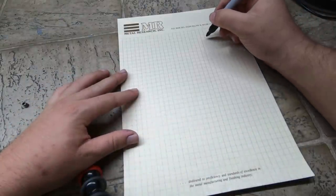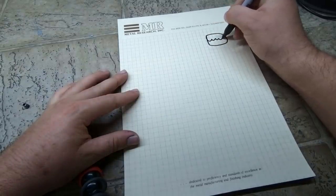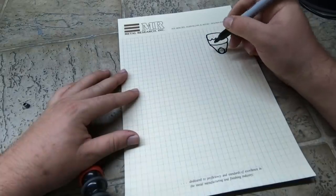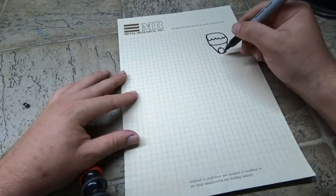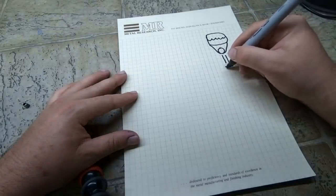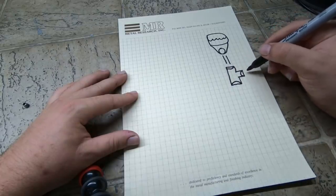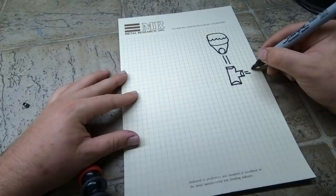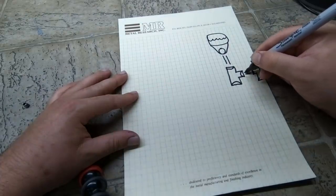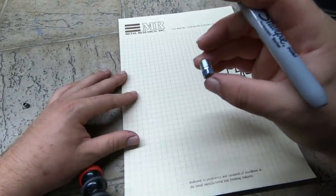I just want to go ahead and draw this out so it's a little easier for you to understand. This right here is the master cylinder with the reservoir on it. This master just has one output. From here, we're going to have brake lines going to a T, and this T is female here, female here, female there, and that T is going to be going to another T that's also female, female, female. So there's going to be a brake line between here with all the fittings that I was talking about earlier. So the pipe's got to be flared.